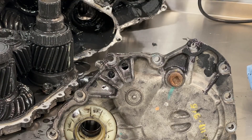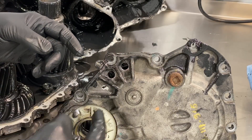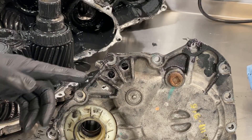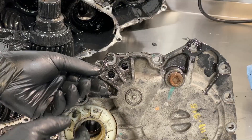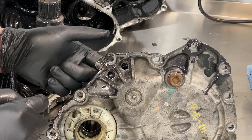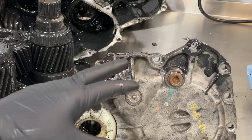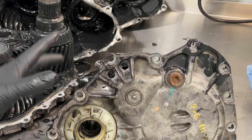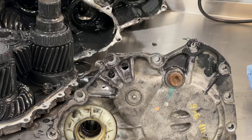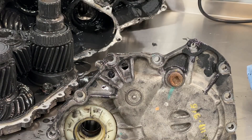When you're drilling into the side of the case, drill slow so it chips and files away instead of pushing big chunks through to the inside. Use a drill nice and slow, and use a vacuum with a small nozzle tip while you're drilling to keep all the chips coming out this way. When you blow through to the back side there may only be a few small chips inside. I chose the side cover over the actual case bottom because drilling into the bottom affects the structural integrity — it takes all the stress as it drives the rear driveshaft and differential.